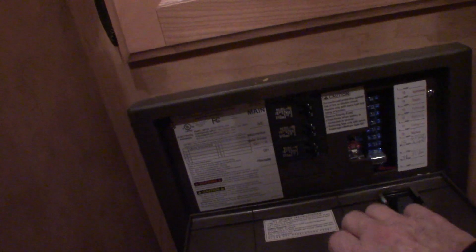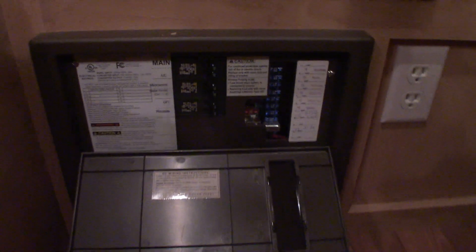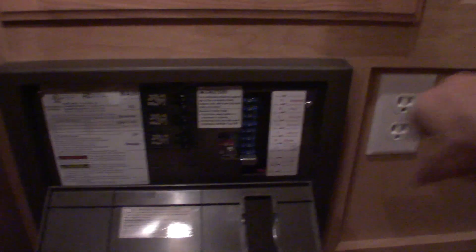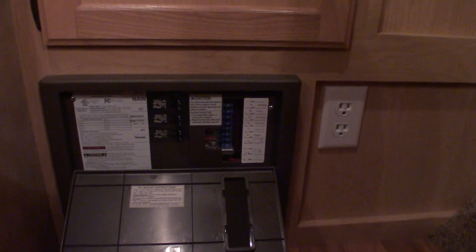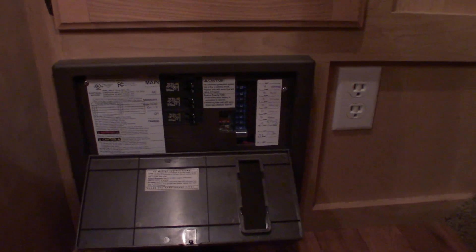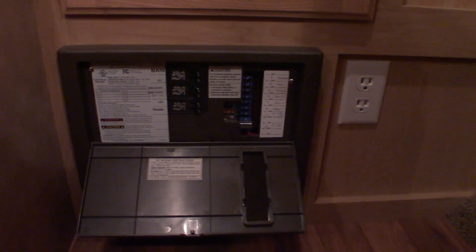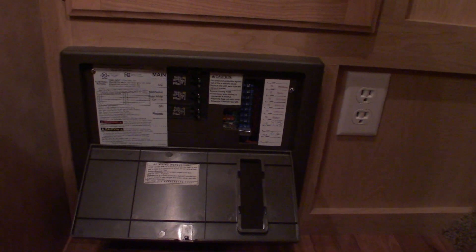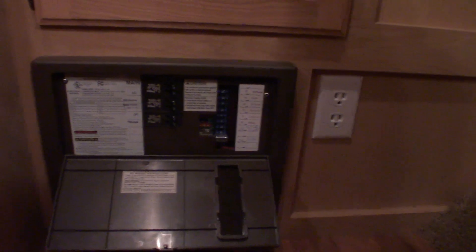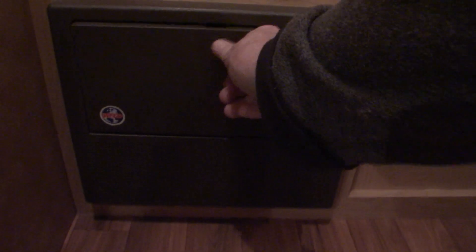This device is your power converter right here. It converts AC to DC power. You have regular 110 AC circuit breakers like you have at home right there, and they're all labeled. Then the power is converted to 12-volt DC on this side — you've got 12-volt fuses here and they're all labeled. Also, when this is plugged in it's a battery tender: it senses how much energy your battery up front needs and sends it accordingly. If the battery is fully charged it'll trickle a couple amps to maintain it; if it's low it'll send 10 amps or whatever it needs. When you're pulling down the road, your tow vehicle's alternator charges the battery through the charge line. If any of these fuses were to blow they light up and you can see them through this tinted plastic here.